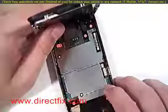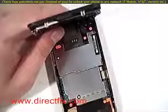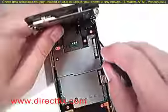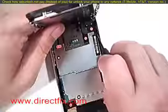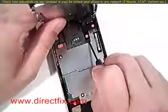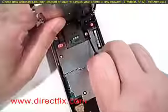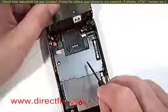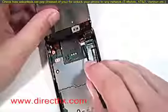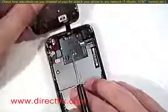There are still three cables holding the display to the motherboard. They are numbered 1, 2, and 3. Make sure you remove them in that order. The third one is a little tricky, as it is pushed in and not just pushed down on the connector. You'll lift a small white tab at the back of the connector up to about a 45 degree angle, and the ribbon will slide out.